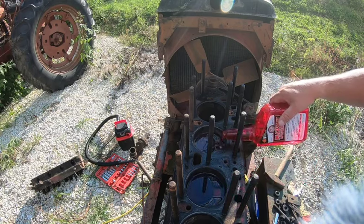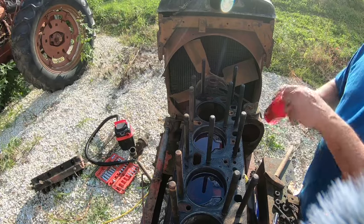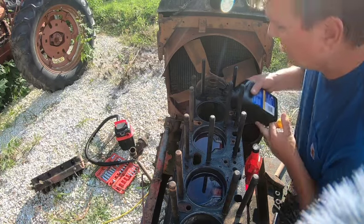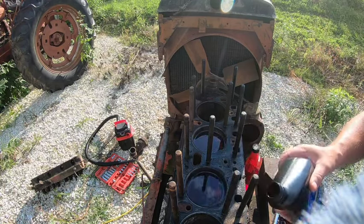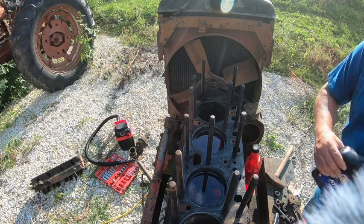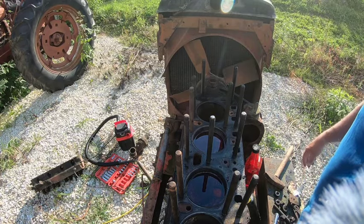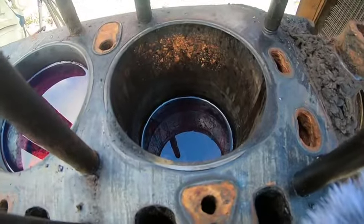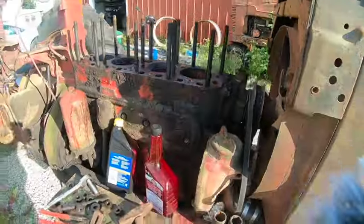I'm just giving it a nice healthy dose of Marvel. We're going to come back over the top of it with some ATF. It's strange how they're the same color and almost the same consistency. Overall, I'm going to let that sit for about another 30 days, wrap a tarp over the top of this, and we will check in on it weekly to see if anything has gone down. That is the overall height right to the top of the piston, so hopefully that's going to start absorbing down through the cylinder.